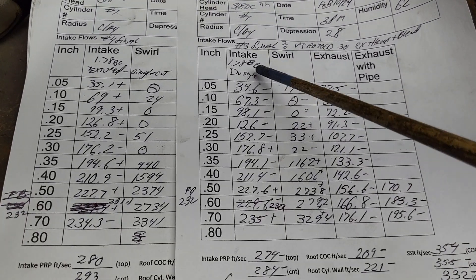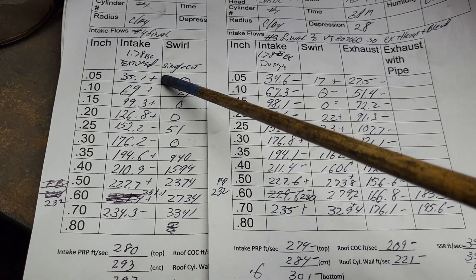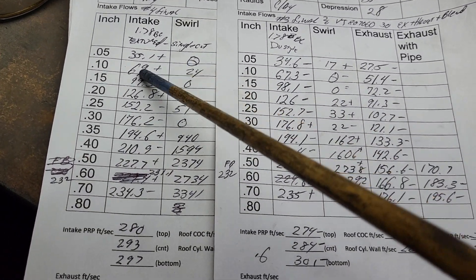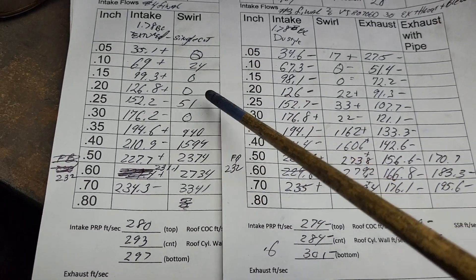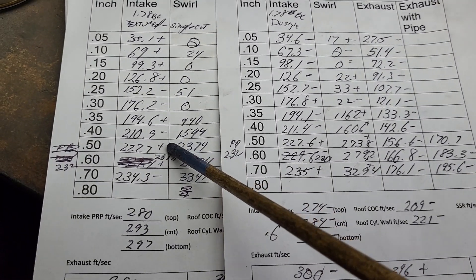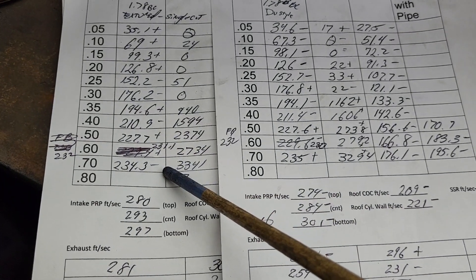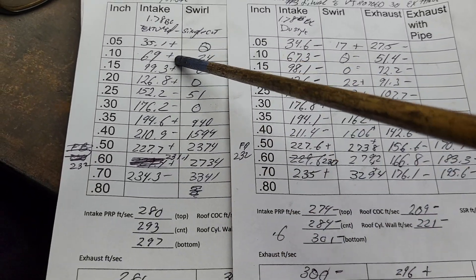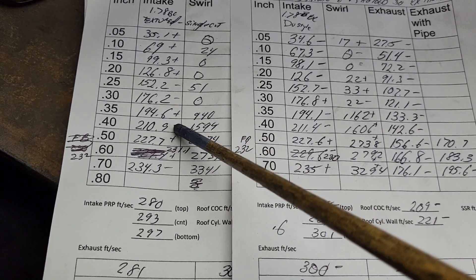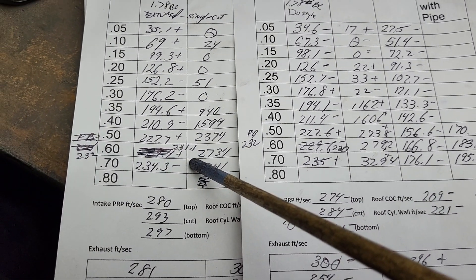And this is DV style with the back cut at 178, but this is smooth. So what happened? Interesting stuff — plus plus plus, not huge pluses, but not bad. Minus minus minus, right — very small minuses. Small plus, small minus, very small plus, very small plus, very small minus. But this one did the fuel better, so as far as I'm concerned I think I would take it. We're still at 231.1 CFM at 600 lift.